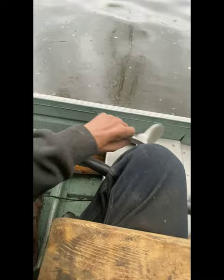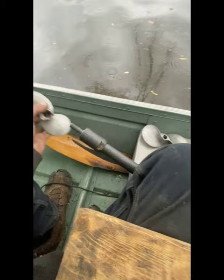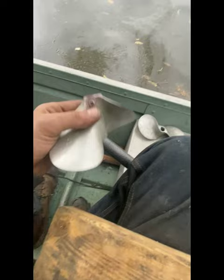I just tried this high speed one here. This is a bit too much prop. It does move, but I actually lost a little speed. This prop is vicious. It really grabs the water and it really throws up a rooster tail. And it does fit. And like I said, you just tap them for M16 and then just tap them for the set screw.